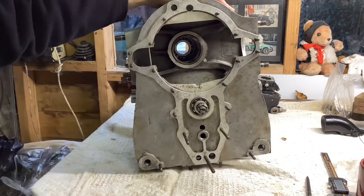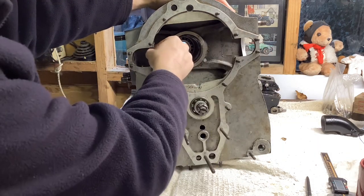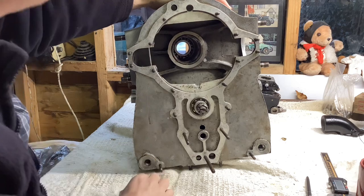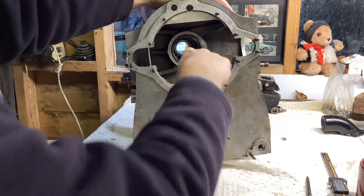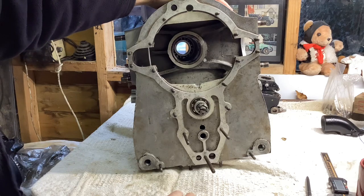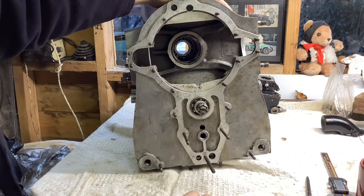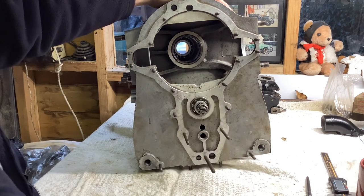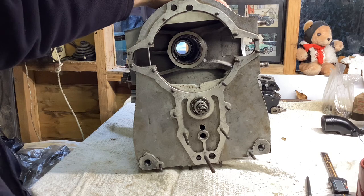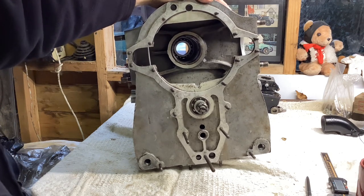On the back there's very little difference from this view. The crankcase is cut away to facilitate pushing the crankshaft in complete with the rods — you remove the dipstick to do it. You fold it up so it's all at bottom dead centre, and then the crankshaft goes straight in complete with the con rods as an assembly. We'll do that when we put the Praga engine together because it's exactly the same.